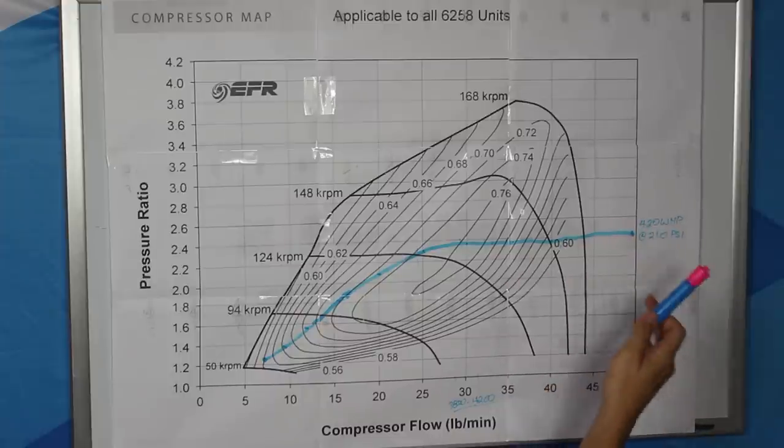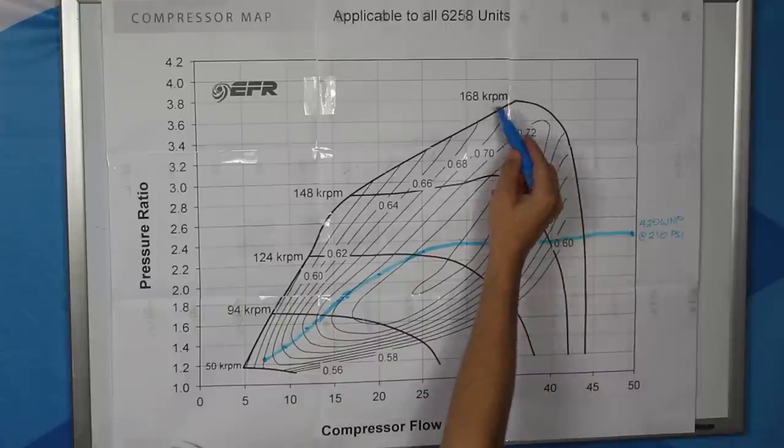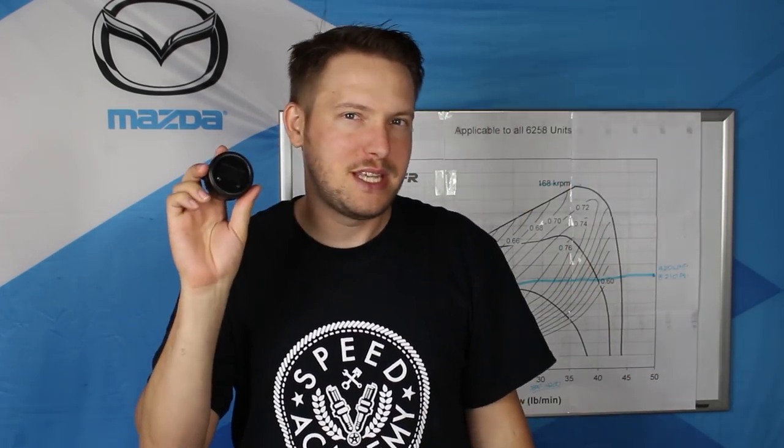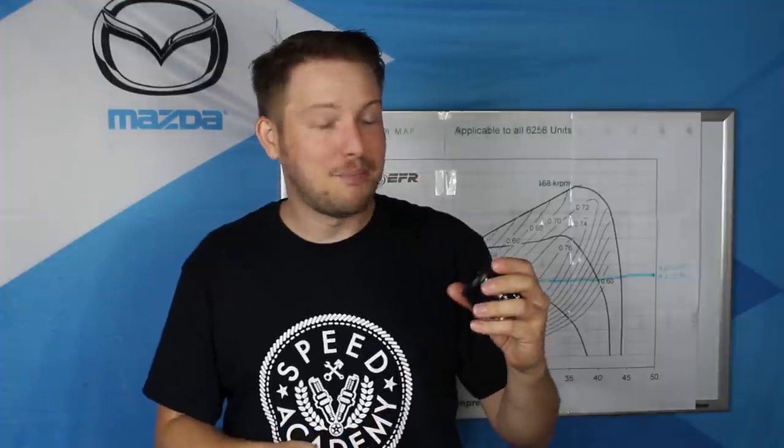As I said earlier, this estimate is affected by fuel type, tuning, and other factors. The main thing I want to find out by installing this turbo speed gauge is: am I spinning the compressor faster than 168,000 RPM? If I do a full throttle run to redline at full boost and the gauge reads 157,000 RPM, that means I can spin the turbo another 10,000 RPM faster — I can turn the boost up and it should make more power. If it reads 168,000 RPM, I'm operating right at the limit of the turbo and there's no more power left. So I'm going to grab my soldering iron, do some wiring, and get this thing installed in the Miata.